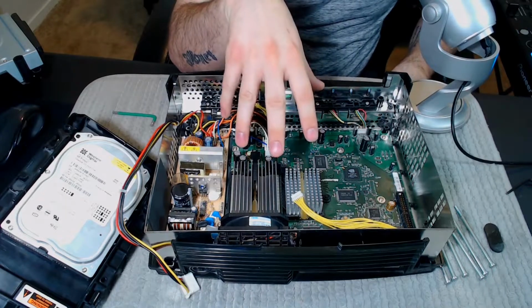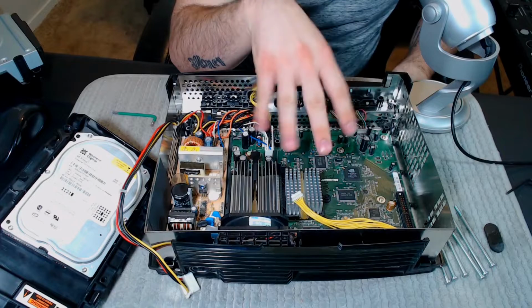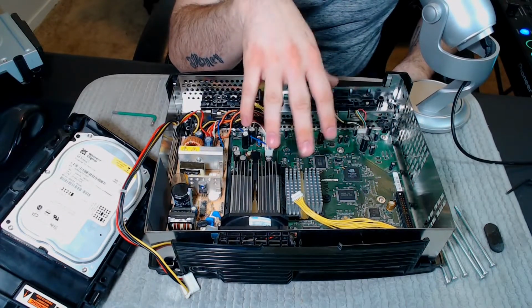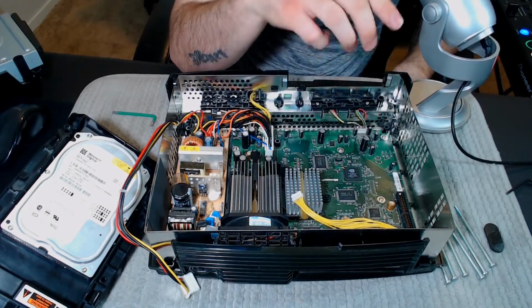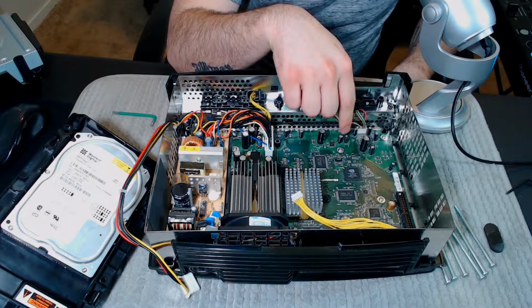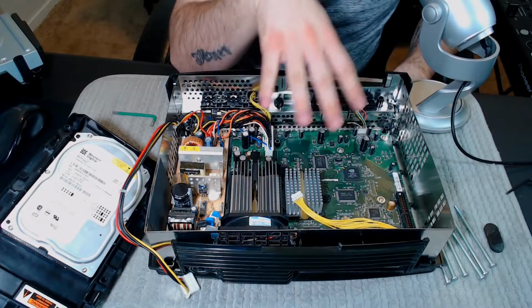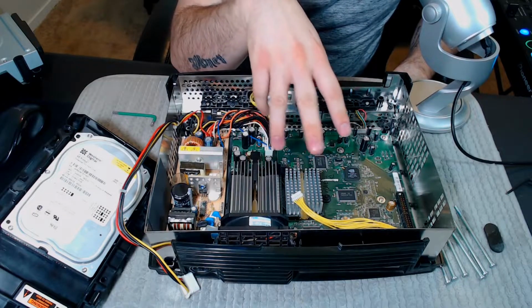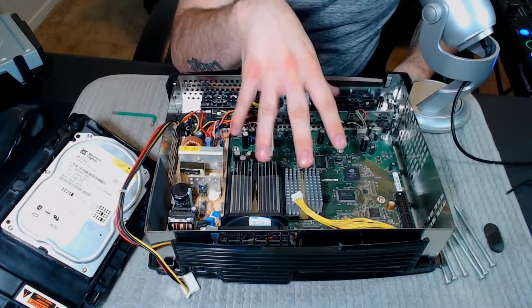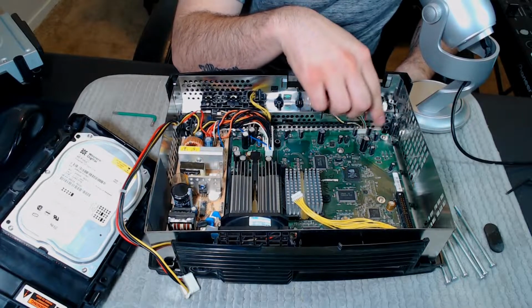Now there are different iterations of the motherboard. It goes from 1.0 to 1.5, and then it jumps to 1.6. I have the 1.6. The 1.0 to 1.5 are the most modded ones, but they do have a clock capacitor problem here that would leak all over the board, and the board would get destroyed. So I would prefer the 1.6, just due to the clock capacitor, but if you want to mod, then get the 1.0 to 1.5 motherboard. But just be very aware of the clock capacitor that would leak all over the motherboard.